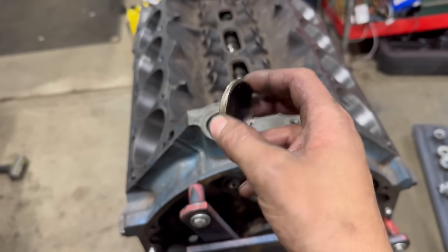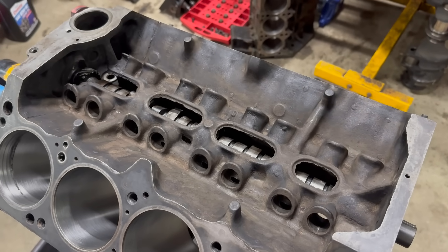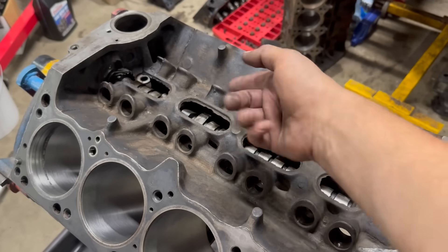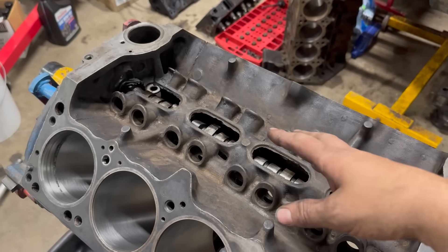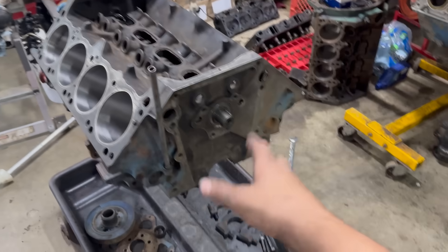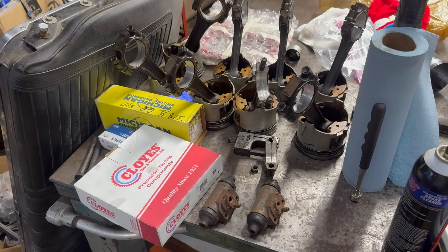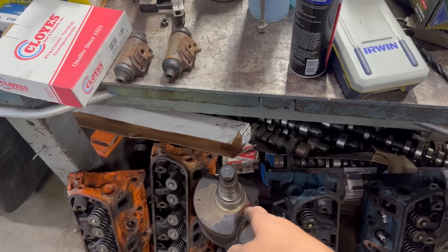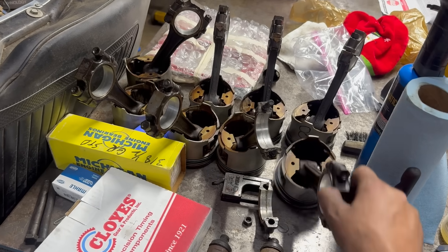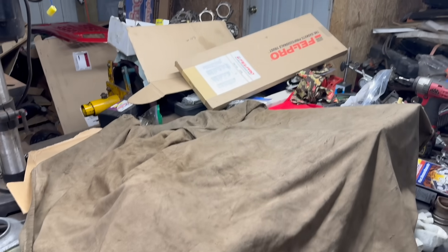I do need to clean up the cam plug — I'll seal it up with some of that aviation stuff and knock that back in the back, and we'll be good to go there. Another quick note on these bearings: these are obviously a press fit, and depending on your block, you may end up with some little metal hairs or shavings coming off as you're driving the bearings in. You need to watch for that — you don't want to leave them behind in the bearing surfaces or anywhere else. So after this is done, it's time for another cleaning. I've got this thing looking pretty good now, but it'll get another spray down and blow out with air. I also still need to hand clean the caps. And then, only then, will we finally be ready to assemble this bad boy. I think at this point we've got all the parts in-house to do that, though I still need to clean more components — the 273 crank we're going to be using, clean the little tiny bits of surface rust off of there, clean these pistons and rods, and probably pull the rings off and clean the grooves behind them of any nasty carbon deposits. We've got a timing chain set, a rod bearing to replace, the main bearings, the gasket set, and all these other fancy parts ready to rock and roll.